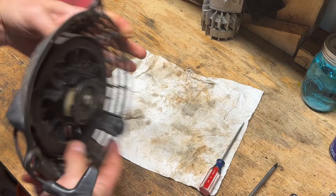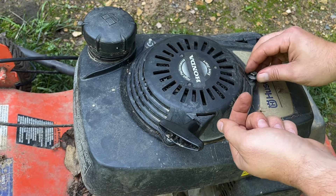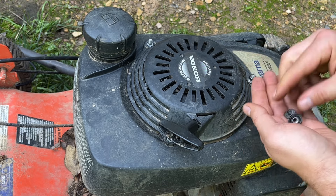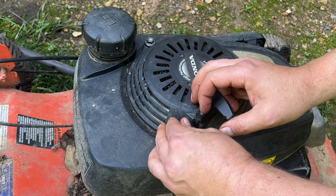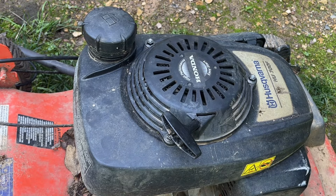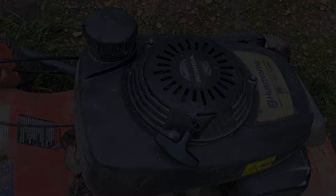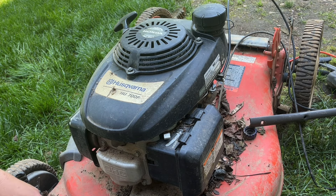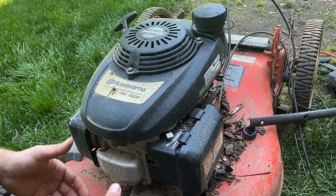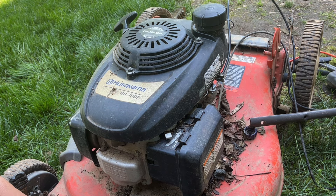We're good to go. Let's get this back outside. To reassemble, we just need to drop this thing on, make sure your studs are lined up, and get those three nuts put back on — 10 millimeter socket again. Hopefully that helps somebody out. If you're interested in seeing me get this guy running, the next video is going to be a carb cleaning video. This Honda actually has the auto return choke lever instead of the heat-actuated auto choke system like on the newer ones. This recoil was kind of the first step in being able to do that, and I figured I'd make a separate video for those who are just interested in it. Thanks for joining me on this one and I'll catch you on the next one.